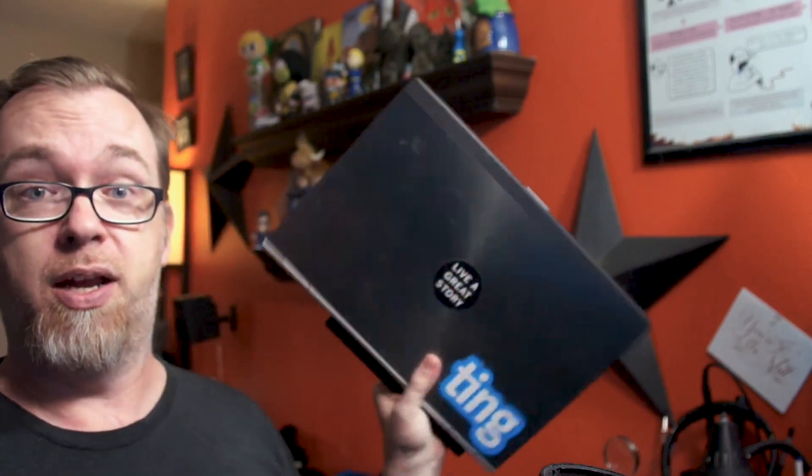In order to turn an old laptop into a more usable Chromebook, you're going to need a few things. First, of course, an old laptop — this is an HP EliteBook that I've had for a few years. The second thing you're going to need is a USB stick. They actually recommend that you do not use a SanDisk USB stick — apparently they've got known issues with compatibility. It needs to be between 8 and 16 gigs minimum.